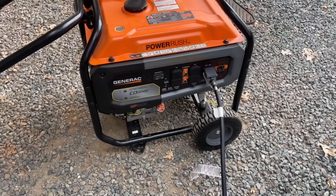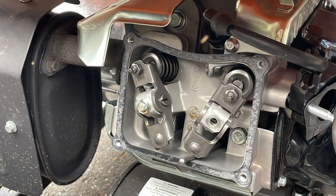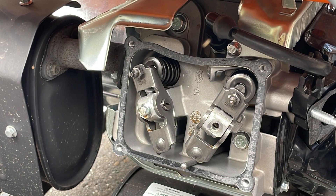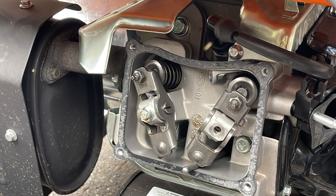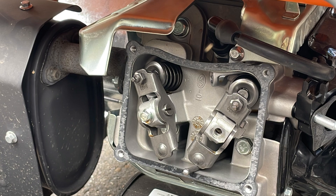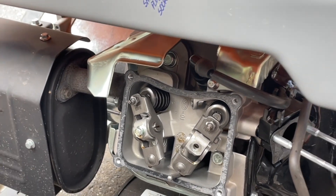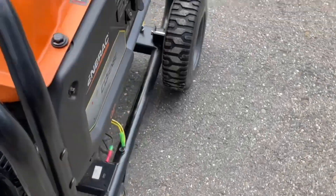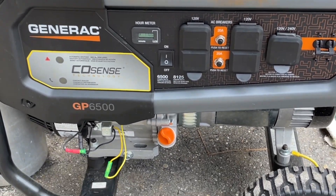So if you've tried everything and haven't been able to figure it out, here we go. Right here, under the cover where the valves are, the little push rod somehow fell out and disconnected from the rocker arm. It's an absolute mystery how that happened. But the end result was that the valve was closed off, so it was getting no fuel. It didn't matter that we sprayed starter fluid in there, cleaned the carburetor — it would not start because that valve was closed off.